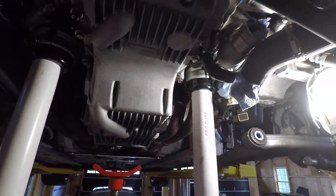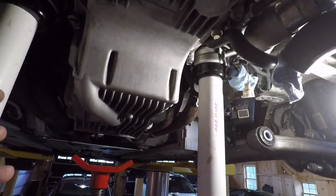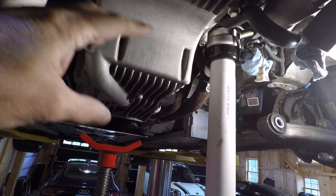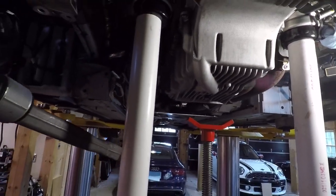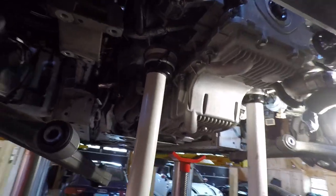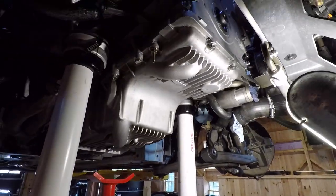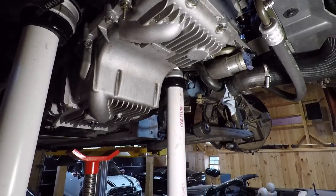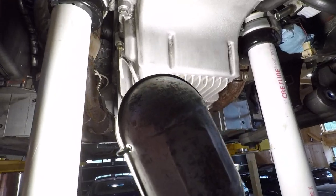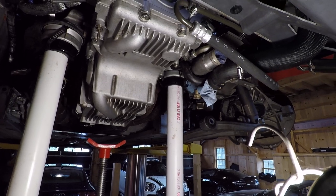It's a lot easier to say, but the backside of it was tricky. Because unfortunately, the sump, once you've unbolted it, won't slide forward — there's other stuff inside of there that's hitting frame members and whatnot from above. That was really a bummer. I thought I'd be able to slide this all forward a few inches and drop it down. I disconnected this to give me more room, but it just wouldn't slide forward. I thought as the header pipe spread open and you tilt the thing a little bit, maybe it would drop out, but there's no way I could figure out how to do it.